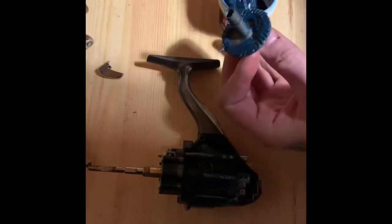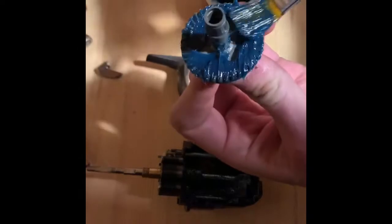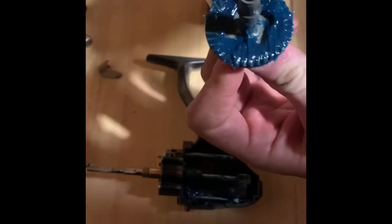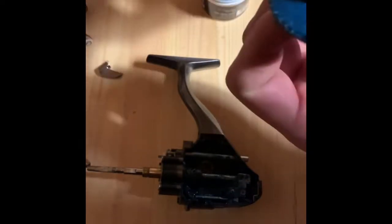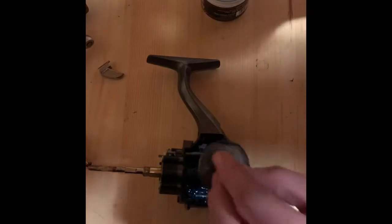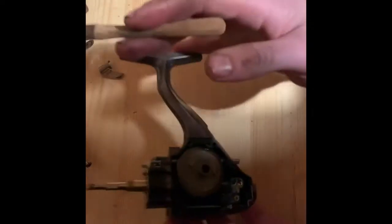Yeah, for the sake of that, you may as well pile it in there. So it's a 2 ounce pot, this is from Amazon, the grease. 2 ounce pot, about 5 quid or something like that. This brush ain't very good, to be fair. It's a bit soft, but it will do the job. So I'll put a bit on there, a bit on the bearings. They're going to slide into the bearings, aren't they? So I'll then put that back inside there, inside that bearing, like that.